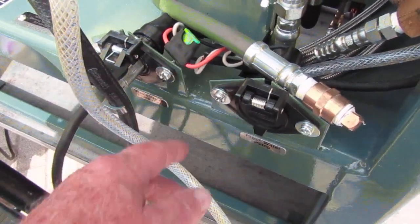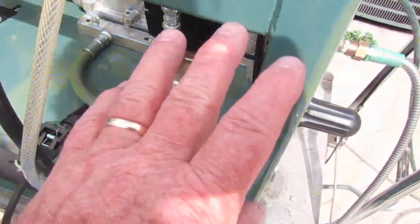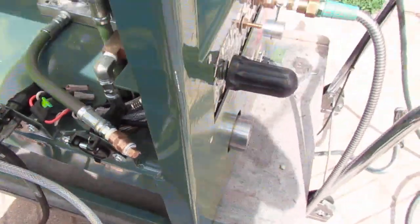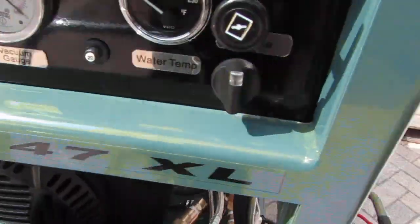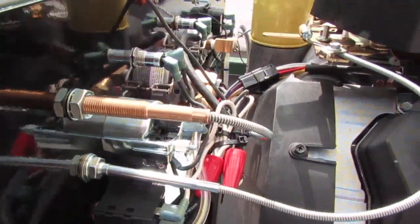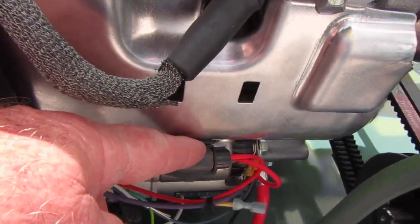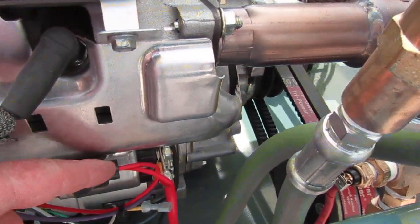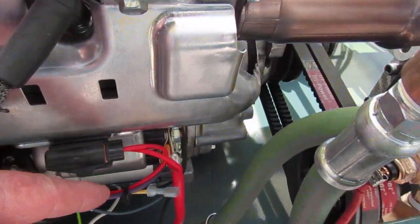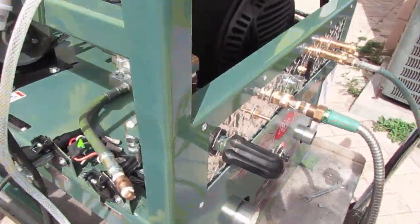Now on the machine itself, there's a separation fuse that separates the two circuits. So if something fails on this line here with the PT33, this fuse will blow — it won't have any effect on the rest of the circuit. The main fuse for this 12 volts is a delayed fuse up here, as well as another fuse over here. So if you lose 12 volts, you'll more than likely have this blow first. We also have a 30 amp fuse here, and if that blows and you can't start your engine and the solenoid is not getting 12 volts to that solenoid starter, chances are it's this that's blown. So the fuses are here, here, delayed fuse on the panel, and a fuse that separates the two accessory lines on this side.